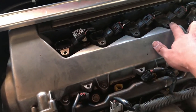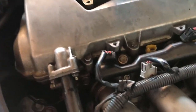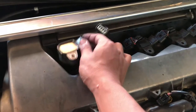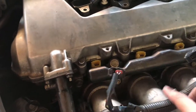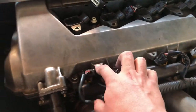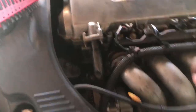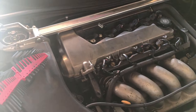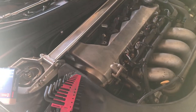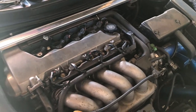To get in there, take out the engine cover — just a bunch of bolts. Same thing for the coils: unplug them and they come right out. For the injectors there are plugs right here, size 12. If you have the engine cover, the bolts are size five. Pull out the fuel rail, take out the injectors. For spark plugs you'll need an extension and a three-eighths drive — take them out and it's fairly easy.